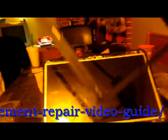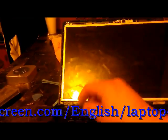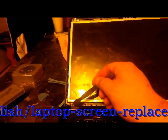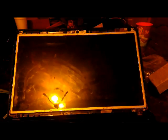Then you remove the plastic piece around the screen. You're going to have screws in each corner — two here at the bottom, and one underneath. Then if you go up to the top corners, there's a screw here and a screw here. So to recap: two at the bottom, one underneath, and one in each top corner. Remove those screws and your LCD will come free from the plastic cover on the front of the laptop.